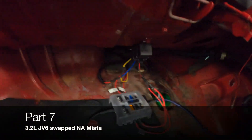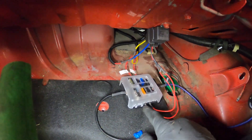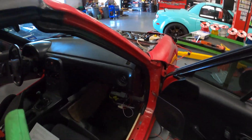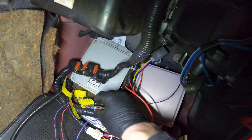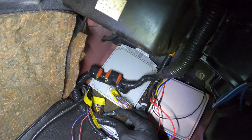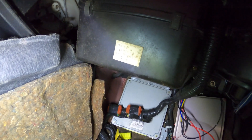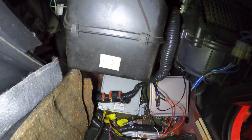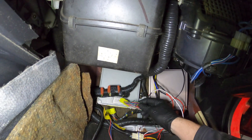Moving back over our fuse box, I went back and put fork terminals on all of these connectors so they go in nicely and they're secure. Then there's a bunch of wiring up here. This is my workspace I've been working with. I snipped a couple of these wires and I did find a 12-volt ignition source here — that's a key-on source — powering our relay which brings 15 amps to the new ECU. All these are wired up.